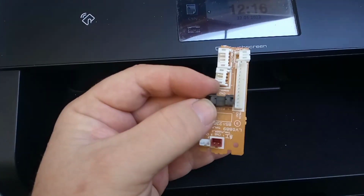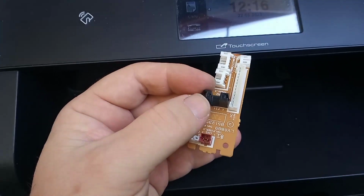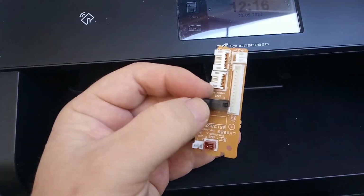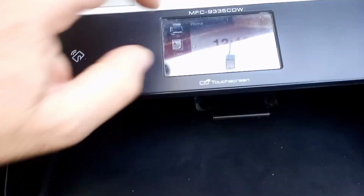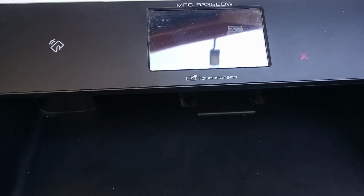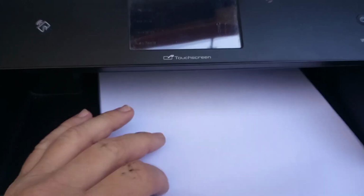So ideally you want to put the machine aside, let it sit for about 30 minutes, and it just allows everything to reach its operating temperature. Makes this infrared receiver just sort of balance itself out, and usually within 10 minutes you'll get a clear indication as if this is working or not. So we'll do it again now. I'd say that machine is now fixed.